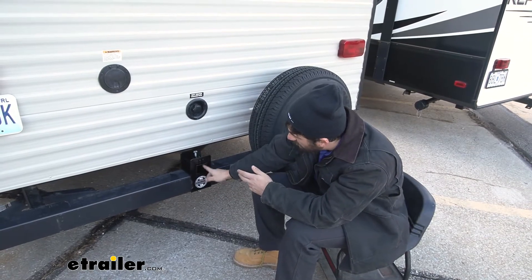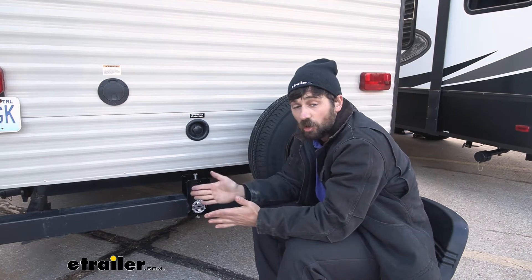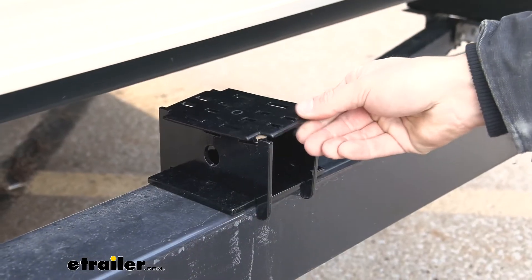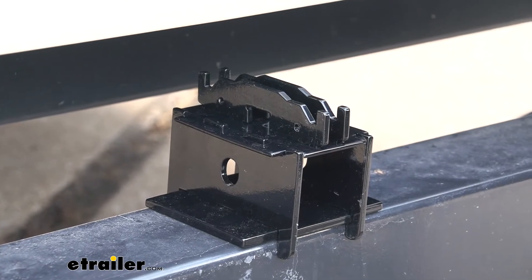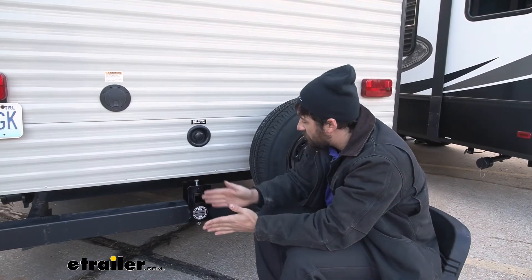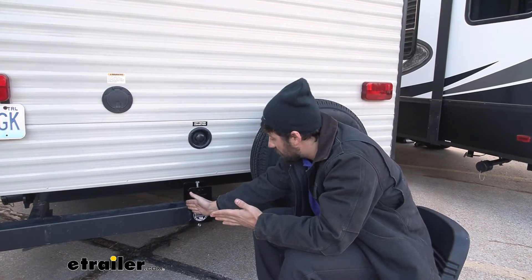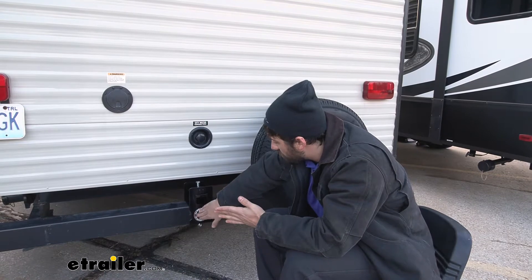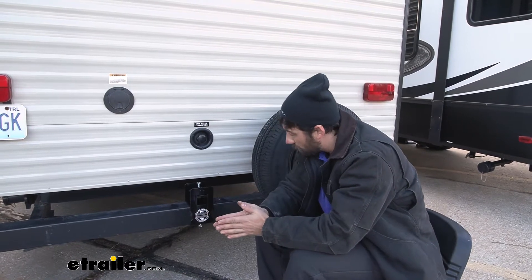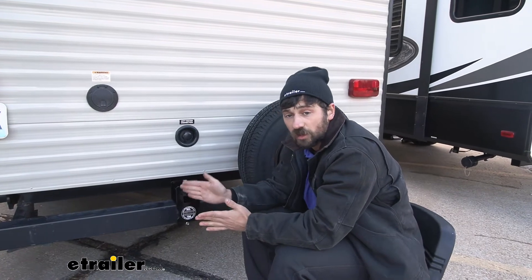Our receiver tube opening here is going to be an industry standard as well — it's going to accept 2-inch hitch-mounted accessories. It does look a little overwhelming at first, but everything really goes only in one way and it's actually pretty easy to install. This bracket design and the tension bolt all work together to evenly distribute the weight of the accessory across the entire surface of the plates on the bumper, so we don't have to risk deforming our bumper or the bolts coming loose and losing our accessory.